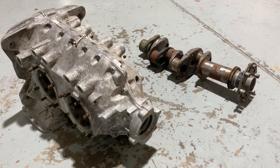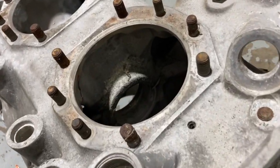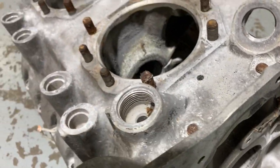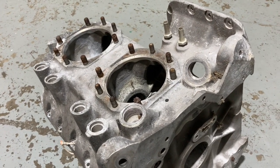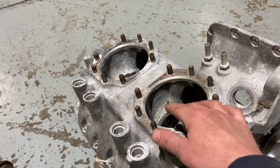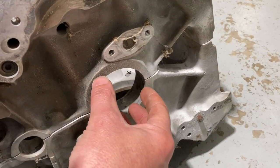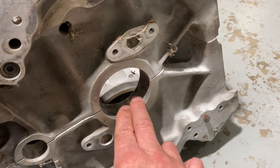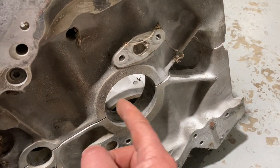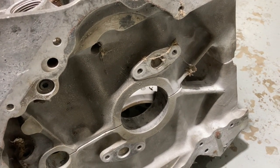I'll briefly explain why there's something to watch for here with what happened to this engine. We're now looking into the engine through one of the cylinder holes. This engine came extremely close to a catastrophic failure because of a problem that does happen on some Lycomings. Where the case halves join at the main bearings, there's a bearing shell inside that has to be clamped tight enough — located with tangs — to maintain the correct clearance on the crankshaft for a film of oil, so it's correctly lubricated and you have good oil pressure.